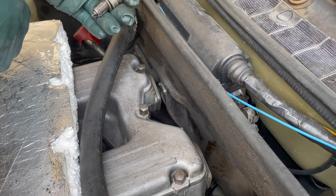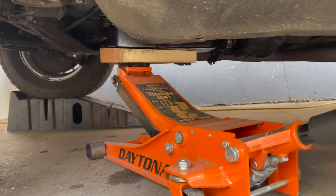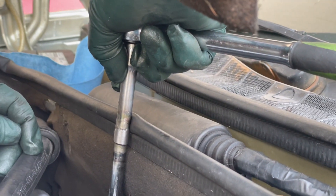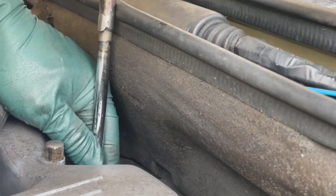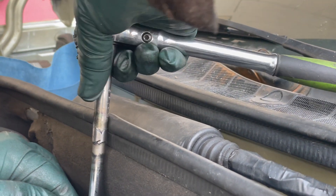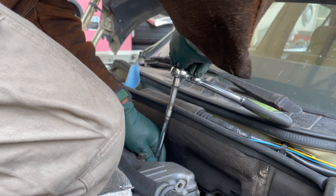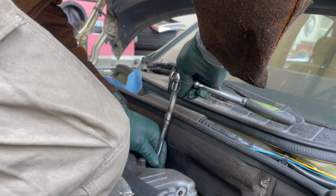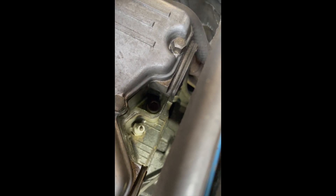If you have a situation like this one where it's real bad, you're going to have to get your hand down in there, possibly. You can do that by jacking up the transmission to raise the rear of the engine. This is where it gets really tricky. You've got to have a certain feel when you run that chaser in — it's not binding up on you. I've got some grease on the threads to help pick up any shavings. You work it down in there until it starts to bind up, then back it up a little bit and feel it again. Just back and forth. Do not get heavy-handed when trying to chase damaged threads. Keep an eye on it as you go down in that hole to make sure that spark plug is staying straight — or straight to the angle that we require.